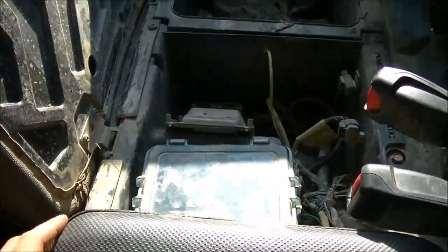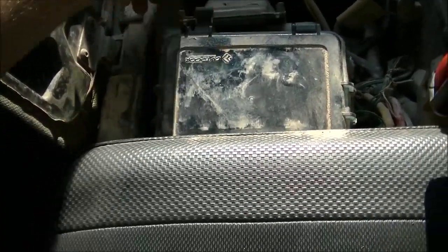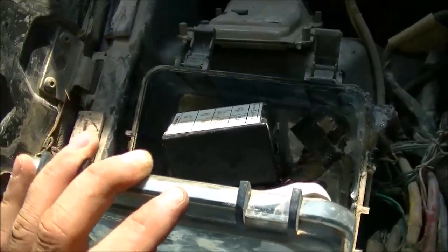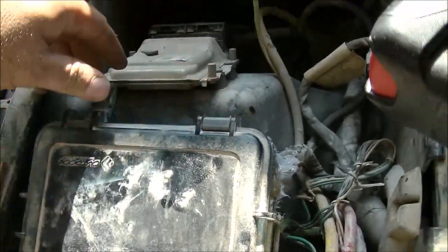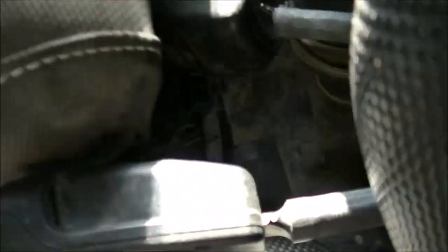Here, I'll show you my fuse box dry box deal too. It's pretty dirty in here, but anyways, you get the point. I did a video on how to do this — I'll post that down below. Pretty much just my fuse box. It's 99.9% waterproof. Some water still gets in through the wire loom, but once I did that, no more check engine light and power steering light when it got wet. That box right there from Walmart, I think like $6. Fits perfect in there.